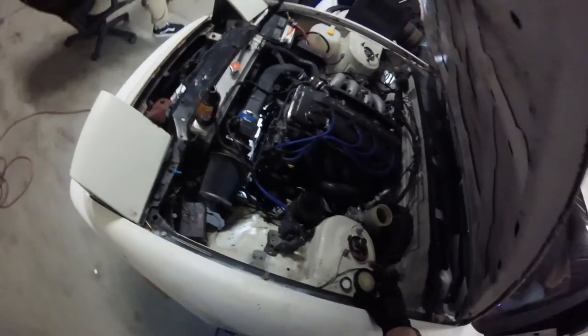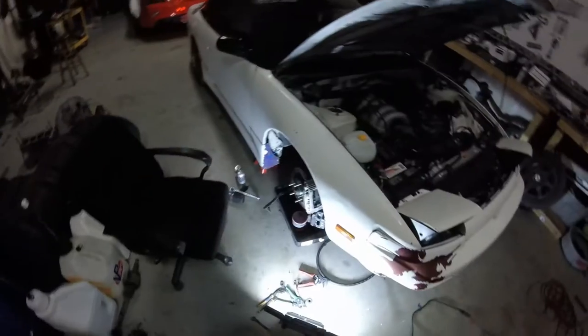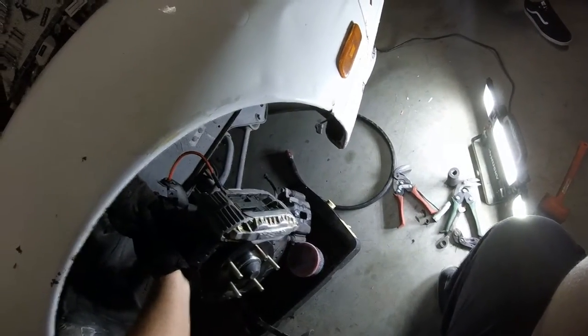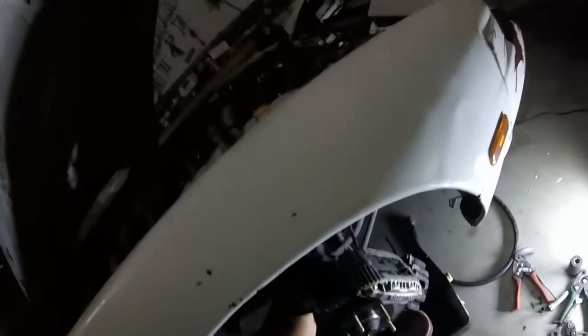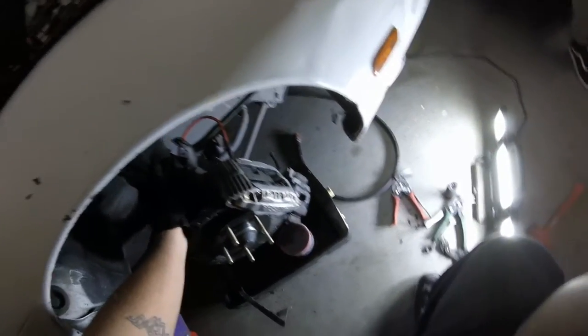Yeah, it's taking it. Keep pumping. Let's see when I see some spillage. Oh, damn it. It's leaking. Fuck. Yeah, this one's leaking. Damn it. Pump it again? Yep, it's leaking. Alright, that's good. I'm gonna have to change this caliper. The other one's not, though. Oh, wait. Pump it again? Yep, that one's leaking too. No, my rebuild sucked. Yep, the rebuild was a fail.